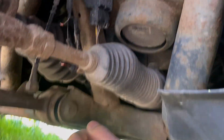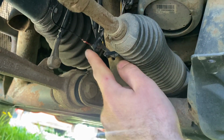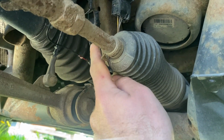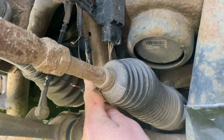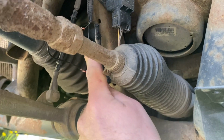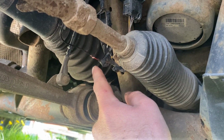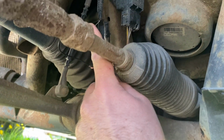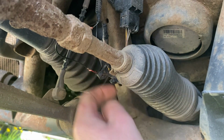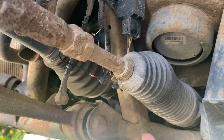So under here, you have the mechanism, and you see I just spliced in the cable there because there was a break. For some reason all of these have been cut. I'm not sure if that's factory or not, and so they're together. But there was a break in one cable. So I am going to make a neat repair here with some heat shrink and some soldering. Tape this all back up, put some protective plastic over it, and this issue should be fixed.